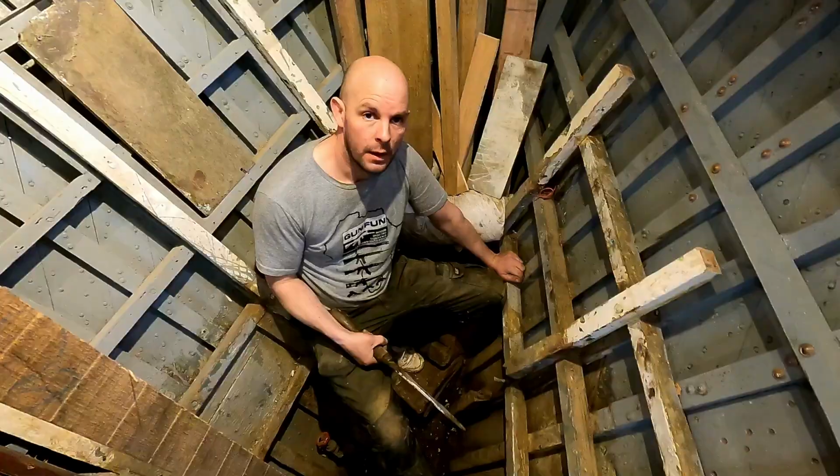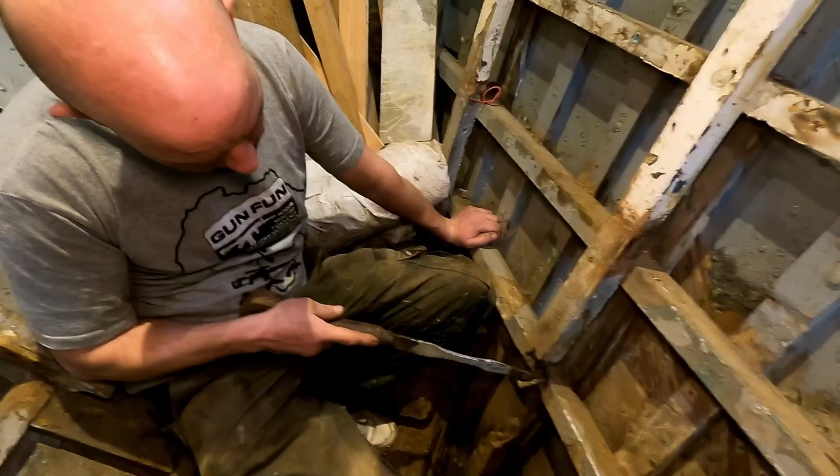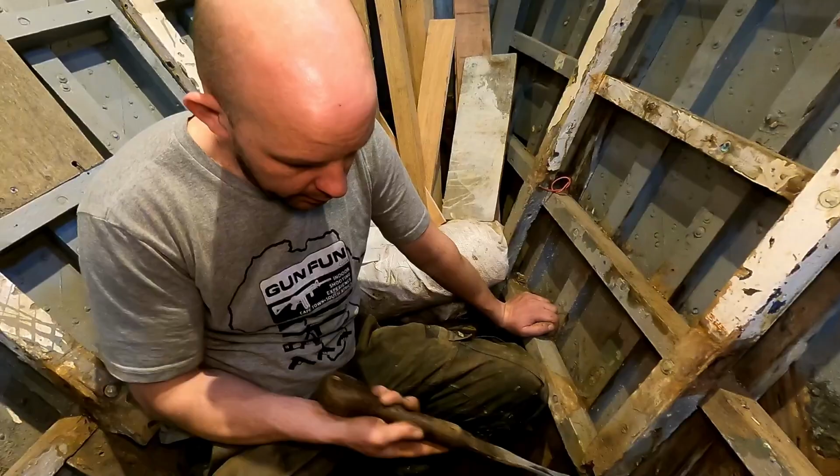Okay, so before we can do the web frame, we need to do a repair on this stringer. Because after revealing, for some reason the stringer right in this location is really poorly. Obviously we probably had fresh water dripping down, it's holding here or something like that.